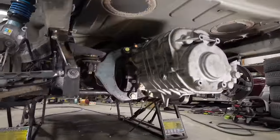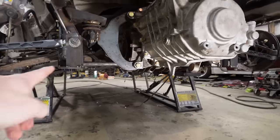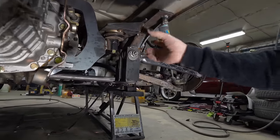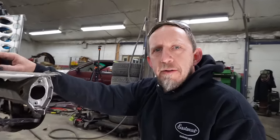We made our rear subframe, we braced it in the front, we braced it everywhere else, but we have not braced it across the back yet. The support here for the toe arm comes down — it's a pretty long piece with no support — so we need to fabricate support for that. Some people like my dry deadpan style. Maybe we should get them to like us before they get to know us. That's usually the way things work.